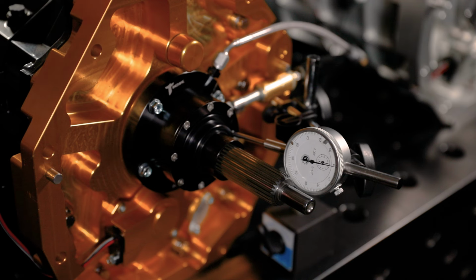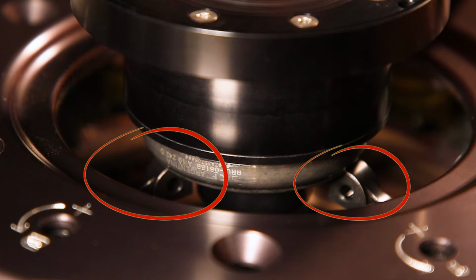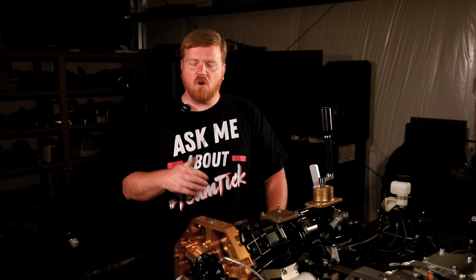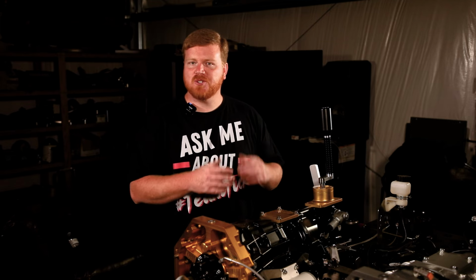In a normal application, what truly retracts the piston of the release bearing itself is the force of the pressure plate. So in a drag race application, we've already touched on this, the pressure plate itself doesn't have a lot of pressure down toward base or at lower RPMs. If you had a 10,000 RPM two-step, it's making plenty of pressure plate pressure to be able to throw the bearing back. But at lower RPMs and normal driving conditions and lower RPM two-steps, all the return, to push the fluid back through the system into the reservoir, to move the piston itself, all the weight of that assembly, all gets moved by the pressure plate itself.